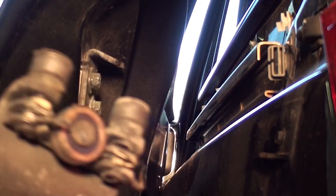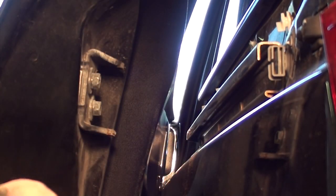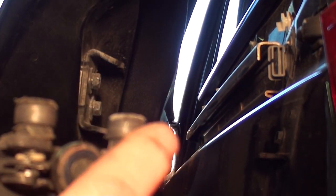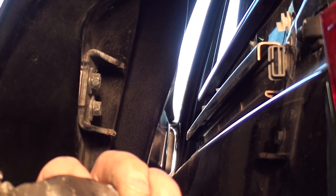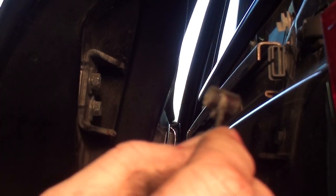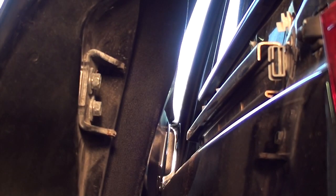This is what we're working with here. You can see the nylon rollers with a steel bearing roller in the middle. There's an updated part for this from Honda that comes with steel on top — a low friction design, they call it. Here are the cables that have been cut. You can see I just slide them out to remove them. There is a nylon bushing on both ends — we're going to reuse those on the new cables, so please do not discard those. We'll keep this roller for reinstallation.